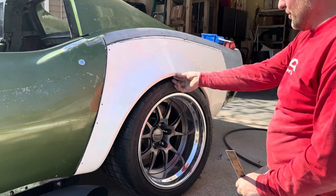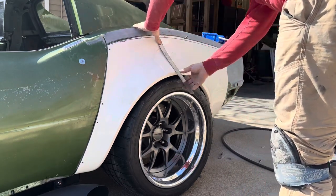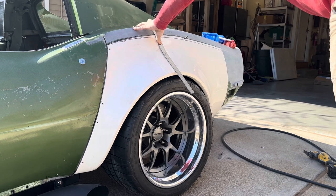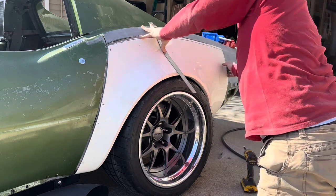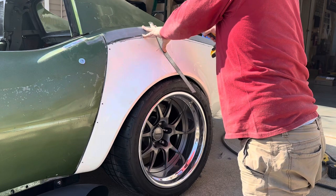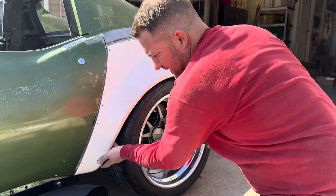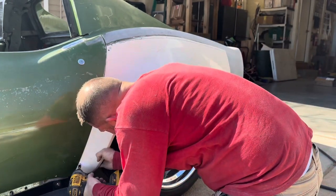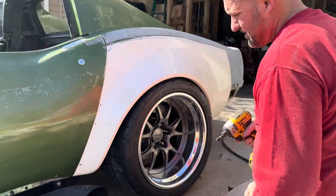One down. So here I'm essentially making sure I'm putting the panel in the same place as the other one. Right now I'm just checking my dimensions — making sure that the top of the fender to the top of the lip matches, to make sure aesthetically it's pretty damn close to the same place as the other one. I'm trying to eliminate as much body work as I can, which is kind of moot because these fenders aren't the exact same thickness as the original, so that body line at the bonding strip is going to get worked. I'm just trying to create the best look on the wheel.